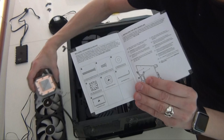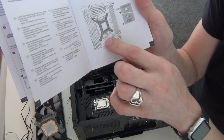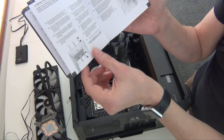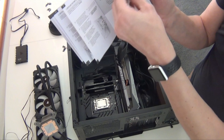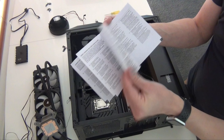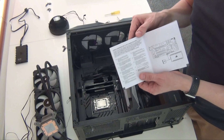The housing plate goes on the back of the motherboard — there's no circuitry there, it's a blank slate that fits on the back. Then the CPU housing fits on the front, and we screw those two pieces together, connected front and back. From there we'll install the radiator kit, mount the CPU assembly onto the CPU, install the control module, connect all the three-pin fan connectors, and plug that into the motherboard so it can control water cooling and the RGB lights appropriately.